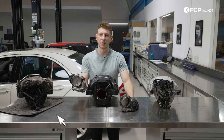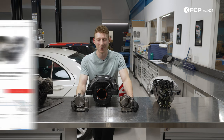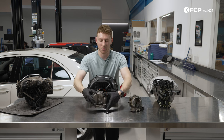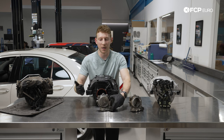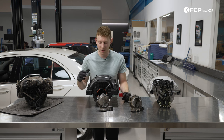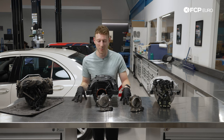This that I have right here is an 82-millimeter throttle body off of an M273 V8. So Mercedes with their OEM Plus upgrade kind of just went into their own parts bin and robbed this off the V8. It's much larger, and this will bolt directly onto the M014 manifold. So: bigger throttle body, bigger intake manifold with zero deterrence from air moving through it. That is why I do the M014 package manifold — all of the airflow, all of the top end.